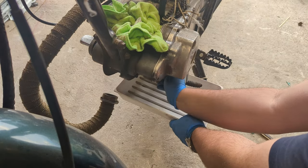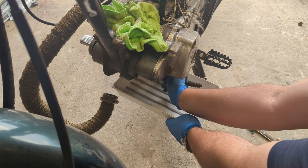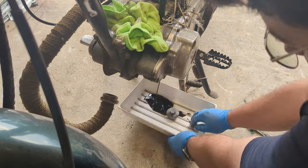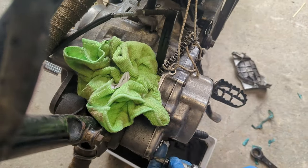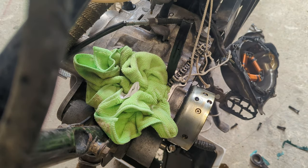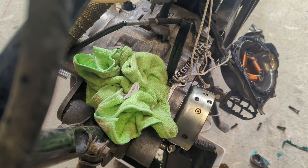Next thing is just to drain the oil because we're going to pop the stator casing off. The reason I've pulled the stator case is because I'm 99.9% sure, looking at the parts diagram, that when the timing chain tensioner came out, it dropped a washer that fell down into the casing here, behind here.